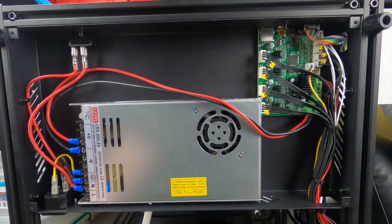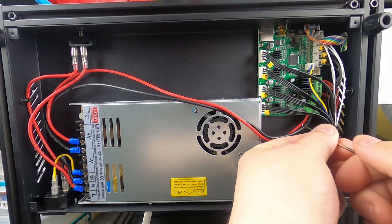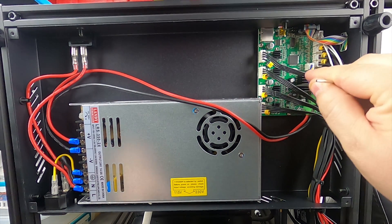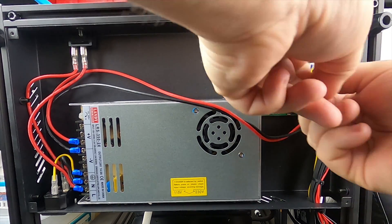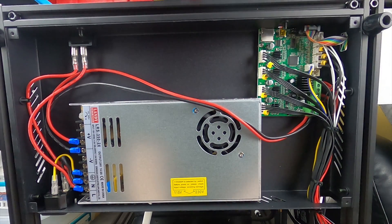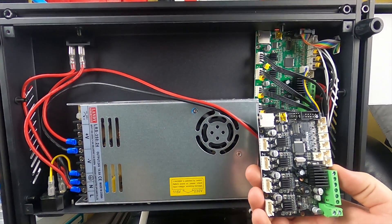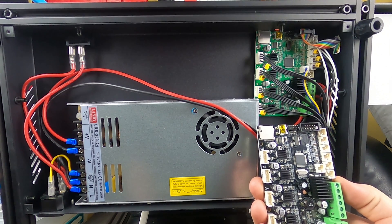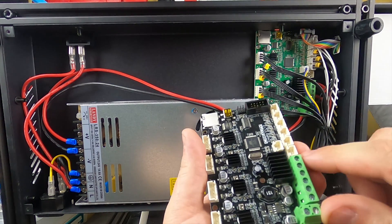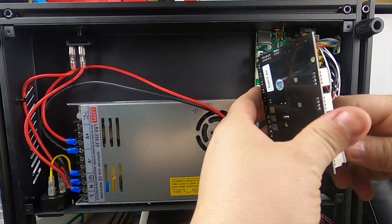Get your little cup or lid and put your screws in there. It's got three or four screws and it's the same allen wrench that took the case off. I'm just going to loosen them all up. We're going to take three of these screws out, leave the top one in, and grab the other board. Here's the other board — as you can see everything on the board is the same, it all lines up the same. The easiest way to do this is just to swap them straight across. Just remember that one right there is the fan header, so you can start popping them off and swapping them to the next one.